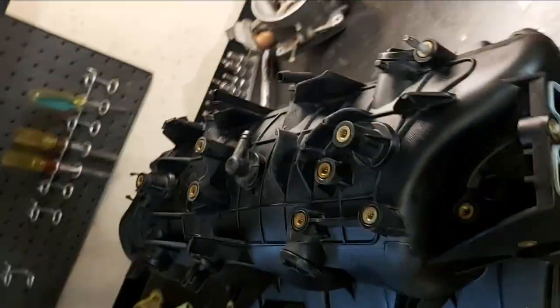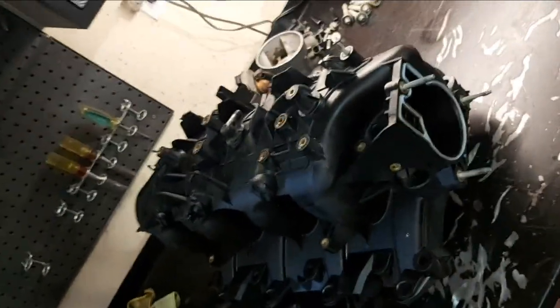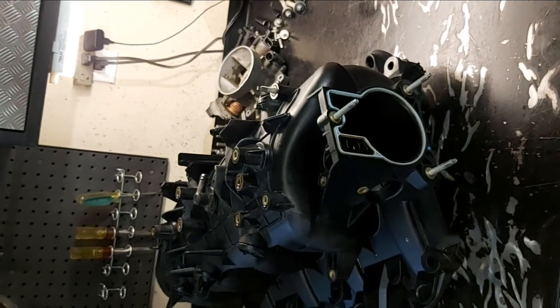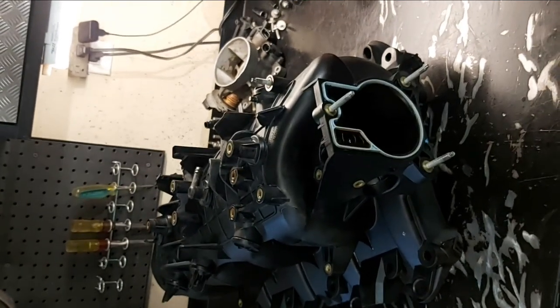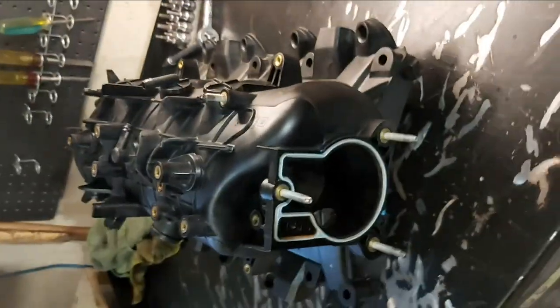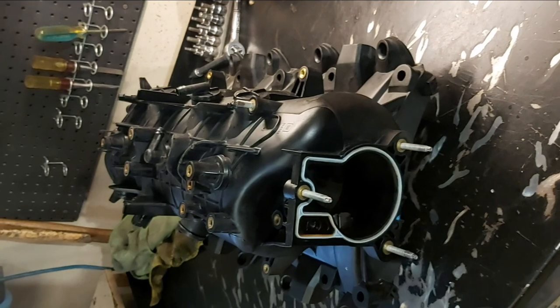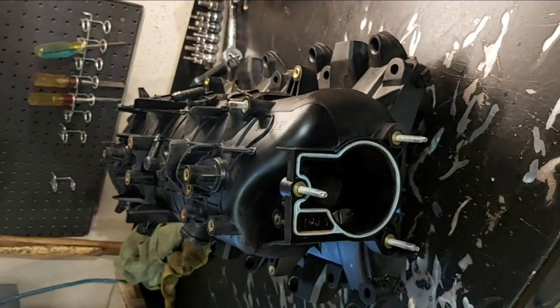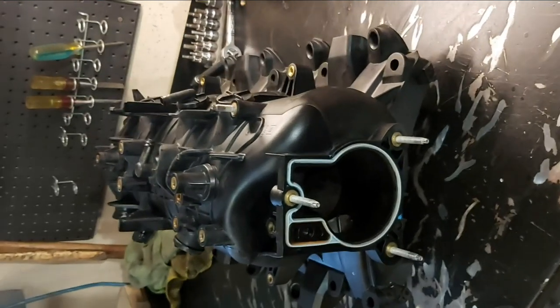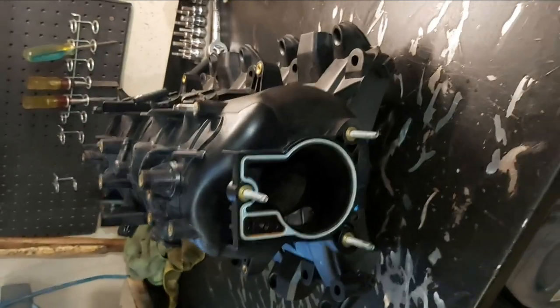So again, just wire brush the stuff on the outside off, clean the inside out a bit, and then we can put this thing together with the snake eater 1500s, and I'll show you what's happening there. You guys can follow along with the procedure to get this intake manifold, or any factory intake, ready for boost. It's a lot cheaper than going with an aftermarket intake, and it doesn't really matter about your efficiency because we're boosted versus normally aspirated, so this will work fine for that application.